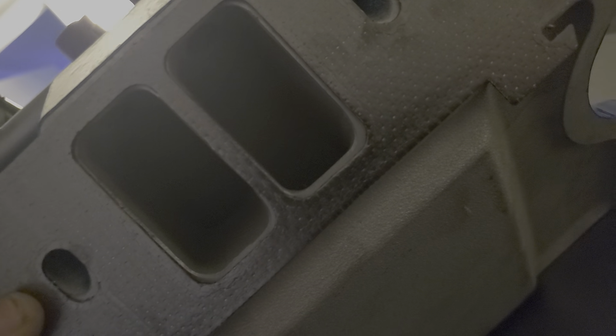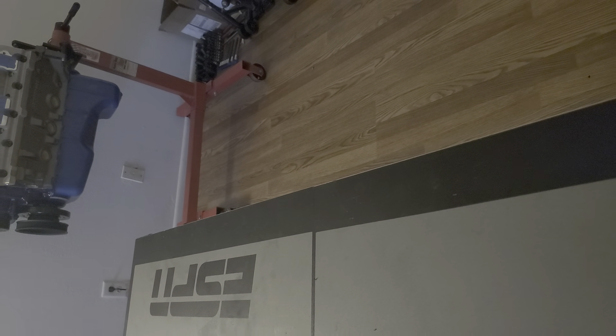That RPM range is spot on what I'm after. It also gets better fuel mileage and makes better horsepower than the stock intake for a Dodge Magnum 5.9. Now, I want to show you guys these gaskets I bought — I was going to port match this intake, or at minimum gasket match it. But when I get this gasket dead center, there's no material to take away. I mean, what are you going to do — port a hair off the intake? It's pointless. There's really no port matching or gasket matching to be done. This intake is top dog.